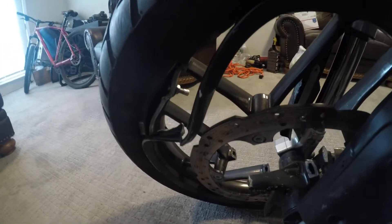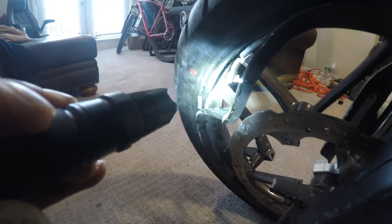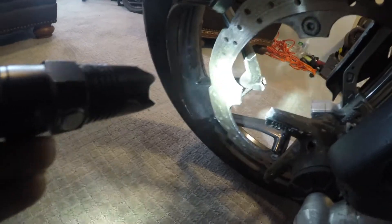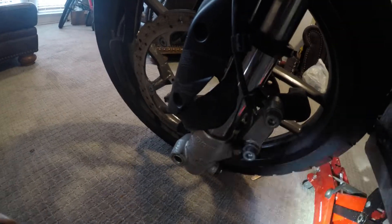I'm going to show you where the force went. Look at the max impact right here - let me see if I can get some better light for you guys so it's not too exposed. As you can see here, that's where the wheel was bulged out. So it looks like they might have gone into a deep hole and hit a rock or something, but the force was great enough to completely shatter this cast wheel.